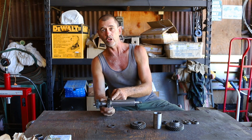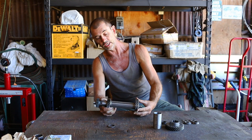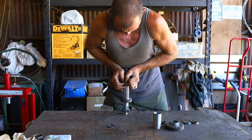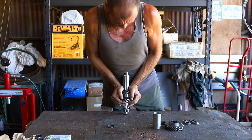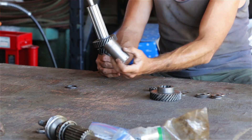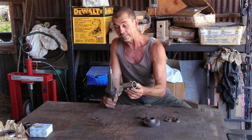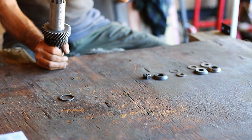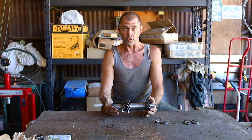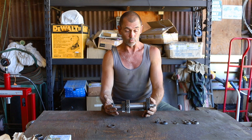These gears have little collars on them and they face the front of the shaft — the one that's got the threads on. Next we have third gear and this one is going to be a little tight. These sleeves are machined to be the right size to eliminate any end float on the gears at all. So if there's any wear on your sleeve, you're going to have to replace it. And lastly, our constant gear with the long collar facing down towards the back of the shaft. Now, if you're dealing with a later model series vehicle like a Series Three, they've done away with all this and it's just one set unit — it either works or it doesn't.